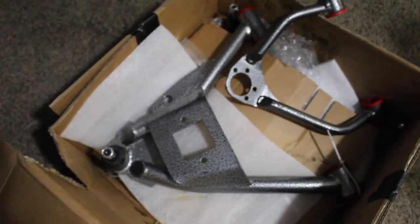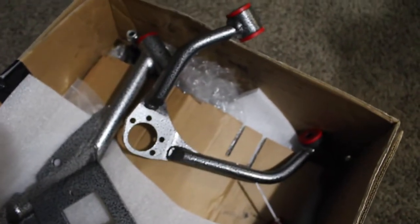The reason I went with the control arms is because I really did not want to mess with my factory shock with a lowering spring or spindle. With the control arms I can just lower the four inches in the front. As you can see here, it came with a second package — those are the u-bolts and everything you need to flip your axle.